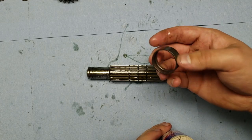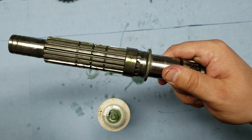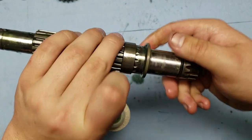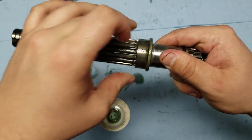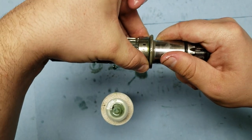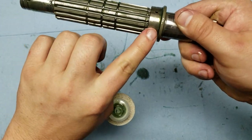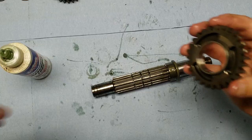I'm going to go ahead and put some assembly lube on it and start putting this thing back together. First off, I'm going to start with the collar — I'm going to make sure I put a bunch of lube on this. While this thing does have the oil gallery holes on it, along with the shaft having the holes as well, this thing is free to move on it. On the inside of the collar it has oil passages, so whenever this rotates over top of the hole, oil will still be able to come on through and squirt out of the holes.